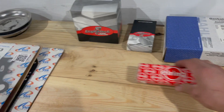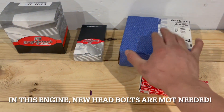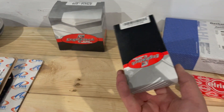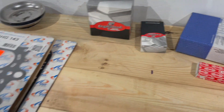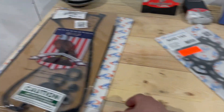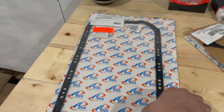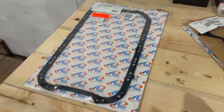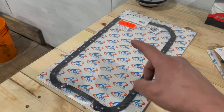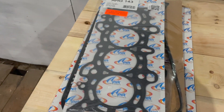Since I'm doing those two main things, I had to order some new head bolts. I have the connecting rods out so I decided to replace the connecting rod bearings as well. I have here a head gasket, valve cover gasket set, and the oil pan gasket. When I was taking apart the vehicle I noticed it was leaking from the oil pan, so that was also an issue.